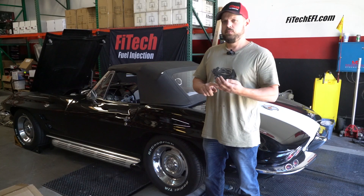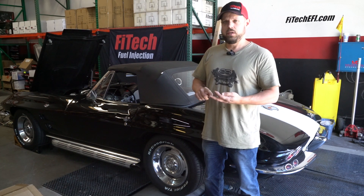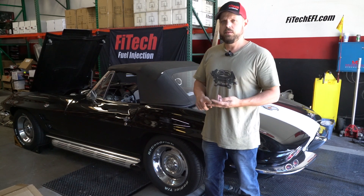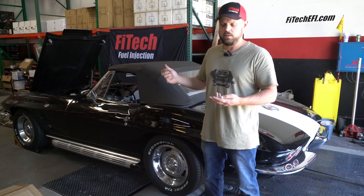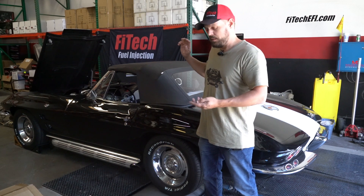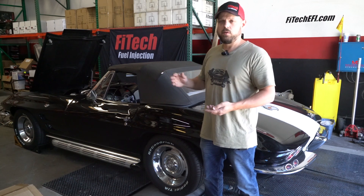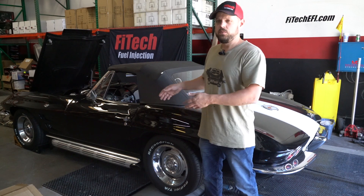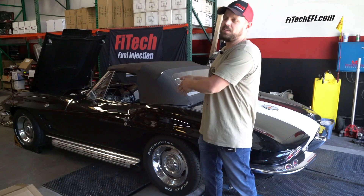After the install, we've got it running. I set the ignition timing, adjusted the idle screw so IAC steps are below 10, got the fuel pressure checked — it's good — and the pressure regulator is preset from the factory so I just need to make sure the fuel filter isn't clogged. I've got it started, idle AFR set, and cam select configured so it's not learning too far away. I'm going to the dyno now — it's going to act just like a road. You can do it with a friend, but I'll be doing it on the dyno by myself.